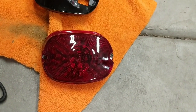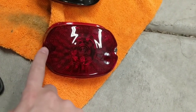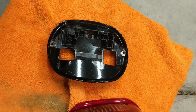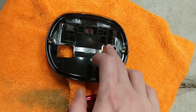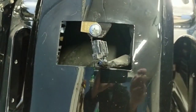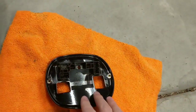When the taillight is still mounted on your bike, you are going to need to remove that and the mounting bracket. There's just two Phillips screws, one on each side of the taillight. Go ahead and pull those out. You're then going to be left with this piece here, obviously with the taillight plugged into it. Unplug the taillight connector and the main wiring connector, and then you'll be able to remove this piece with one Phillips screw right in the middle. Remove that and you can get everything off.